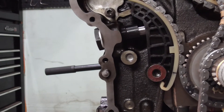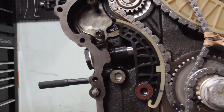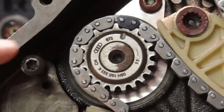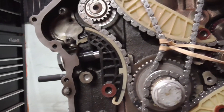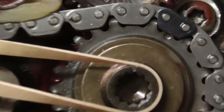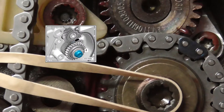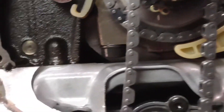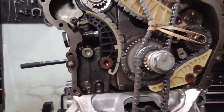As you saw, we just installed our balance shaft chain tensioner against the pivot rail for the chain. One of our balance shafts we had installed in another video — that link lines up where it needs to be, everything's torqued. We've got guide rails, and over here our other link lines up to the mark, and these gear sets are lined up where they need to be.